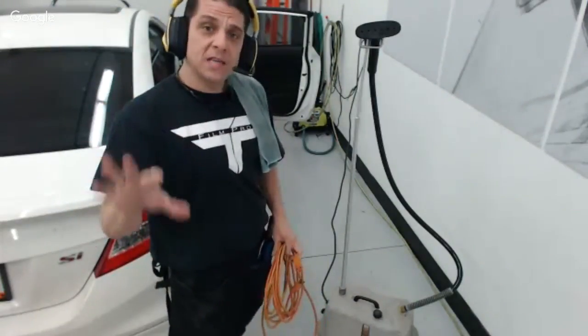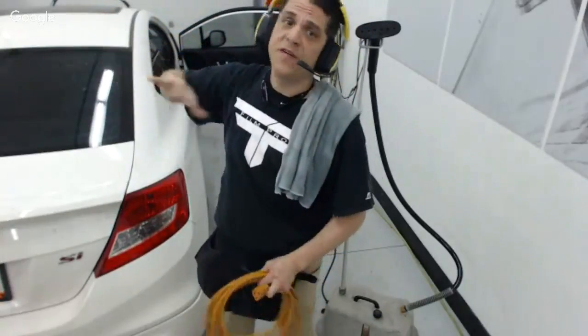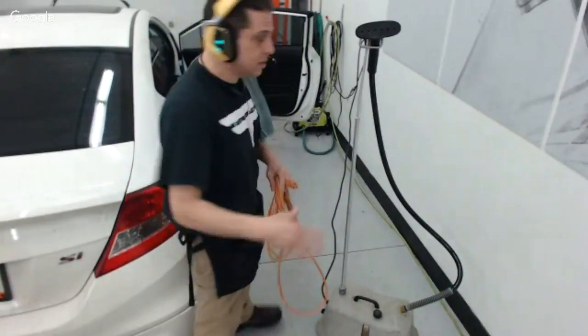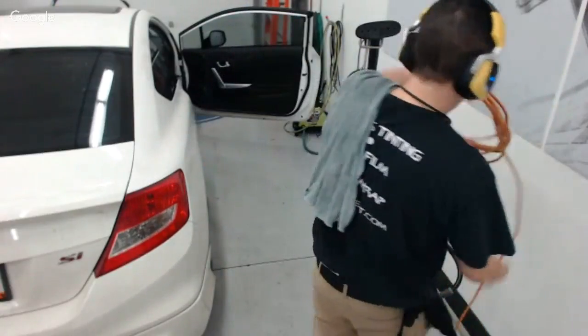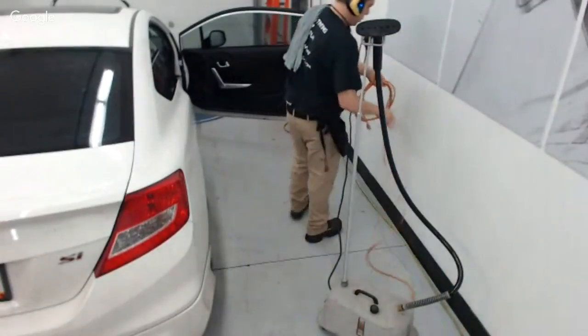You can use the plastic bag method. That's where you peel the film off. If it comes off in one piece, fantastic. Spray the glass with multi-purpose cleaner and then put the film back up and let it sit and soak for a while. Maybe pull it back down, spray again, put it back up. You can use that method. Trust me, it works. But I've told different people before that the professional method for stripping window film is to use a steamer.